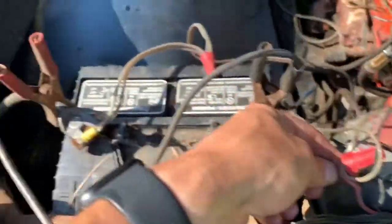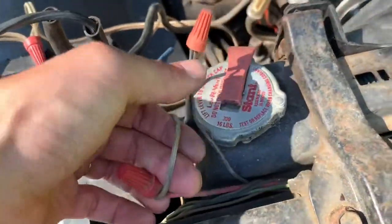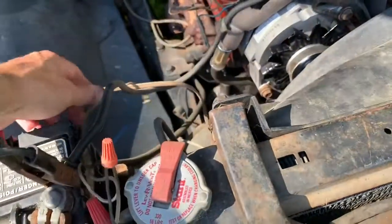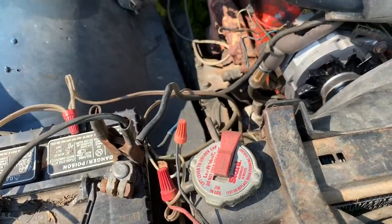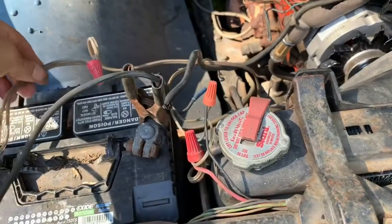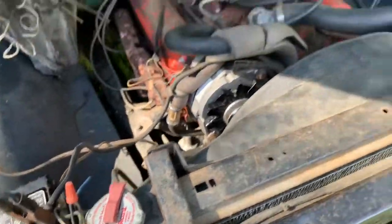So those two wires here get fed to this one red wire, and then across the red wire and the black wire is our high-tech fuse. So that ain't gonna do it. I mean, it works, but I can't believe somebody went through the trouble to actually solder that on. I mean, if it was me and I was gonna go and use wire nuts and speaker wire, I just wouldn't have even used the fuse, but whatever. I'll get that all straightened out. I've got a bunch of wiring to straighten out.